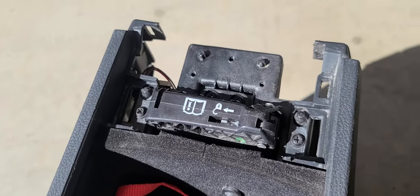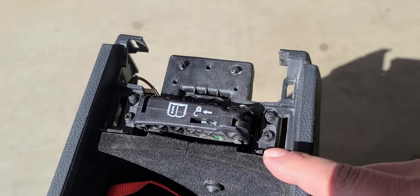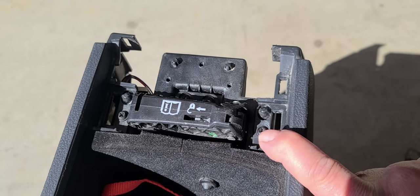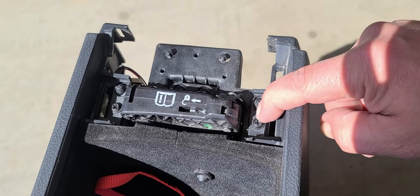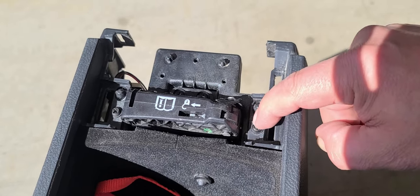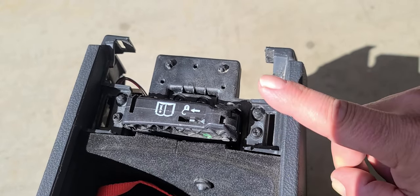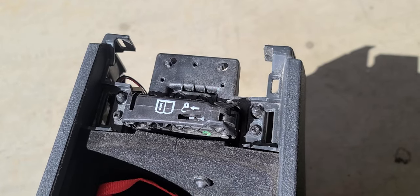We're going to start by removing these two screws — they're both Phillips head right here. We do recommend replacing them with a different head type of screw. They are a number eight coarse thread; the factory ones are half inch. You can use three quarter if you need to, but go to a hardware store and get a different head type. I do not provide them because I would like everybody to have different head types so a thief never knows what situation they're walking into.